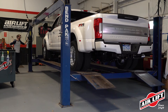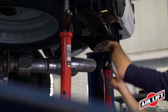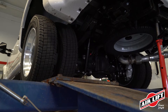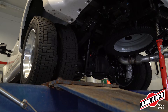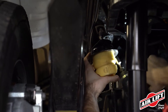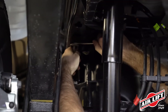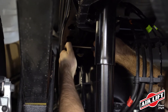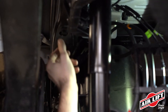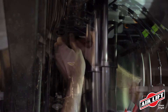Raise the truck with a floor jack and support the frame with safety stands. For filming purposes, we're using a drive-on vehicle hoist. Drop the axle low enough to later set the air spring assemblies into position between the frame and the axle. Unbolt and remove the jounce bumper assembly from both sides. Remove the clip-in studs by prying on the hinged end with a screwdriver to release, and pull all four out of the frame. Install the universal nuts into the frame rail, lining up the holes in the frame and the threads in the nuts so that a bolt can be installed.